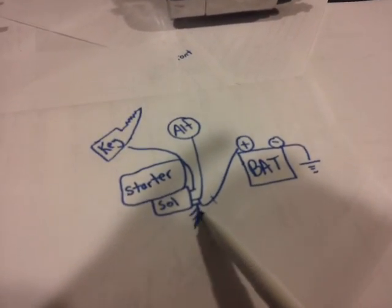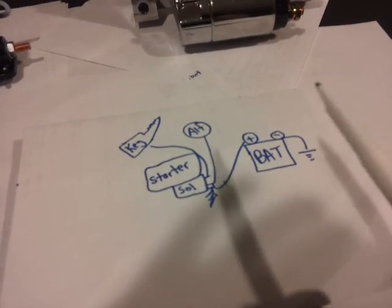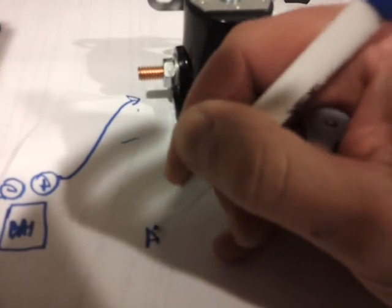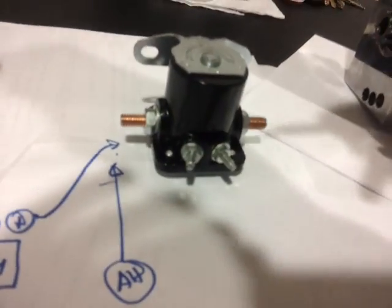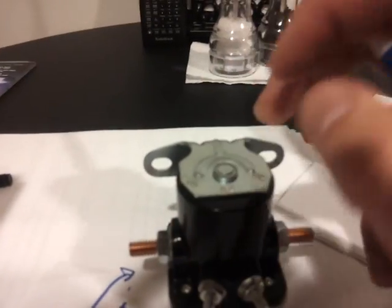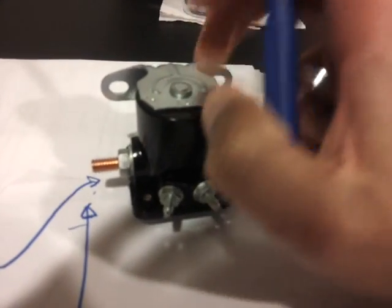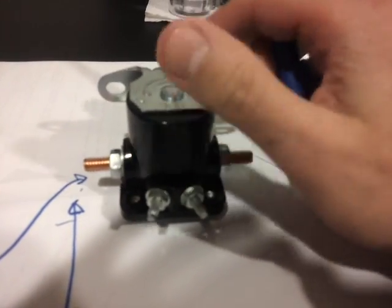Remember how I said everything on this thick stud is like a junction block? You're going to take all these wires and move them right here, because this is your hot side now. This was the hot side, but no more. This will be empty now. I'll put one thing here, the alternator, and everything else, the fusible links, goes here on the hot side. This one grounds on the body. If you have any questions on how this works, I made a video on just this. Check out my channel, it's called starter solenoid troubleshooting.